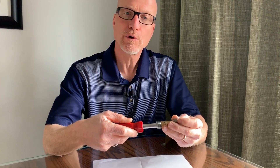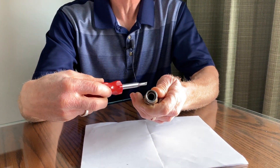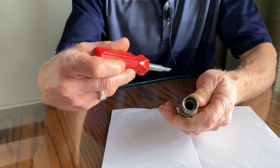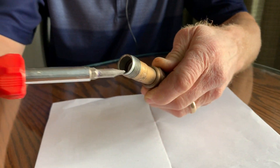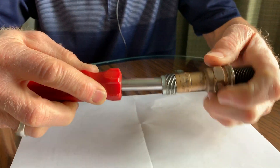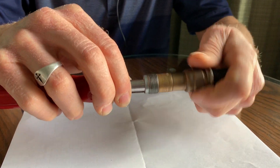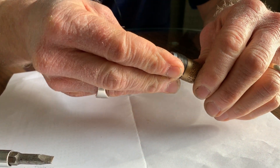The way you can tell — and by the way, I have my wife's handy-dandy kitchen screwdriver here that will even work for these purposes — so the way you can tell if it's an old style is you take a straight blade screwdriver, and if there is a slotted screw down in the end, right in the well here. I'm going to take a screwdriver down in the ignition lead end of the spark plug and actually unscrew that little straight slot screw in the spark plug, and then we're going to carefully pull this apart to see what we have in here.